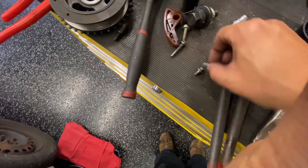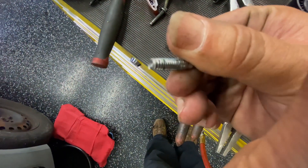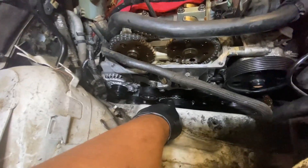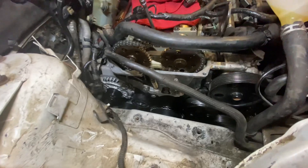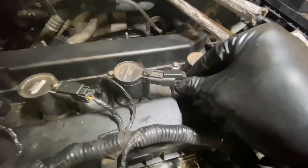There's the whole completed bolt — it's out. Now, on to the rest of the job, which is I've got to put this in its place and hope to God that it fits. I got the crankshaft back on; the crankshaft pulley is back on and got it back to top dead center. Just did two revolutions, stuck the blue bar back in and it passed. So we are 100% certain that we are at TDC at this point.